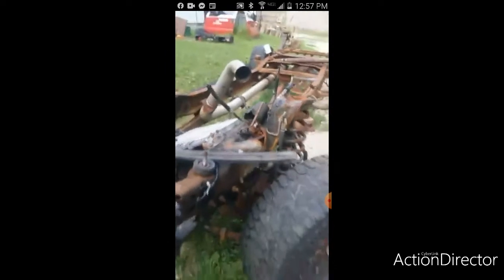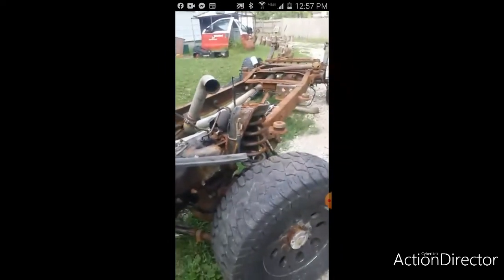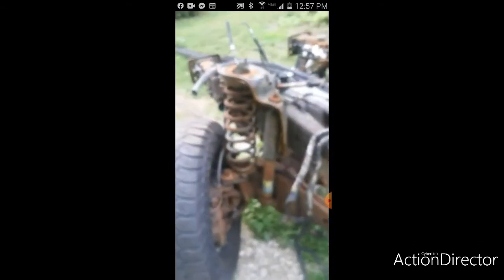We're hoping to get the semi bag in there, but if my semi bag won't fit, we got another bag that will do the job. And it's almost the same width as this coil spring, but just a little bit fatter. So we're gonna be taking that leaf spring setup on that thing over there and going with the radius arm setup, which means I will have to custom mount all this. We're gonna have to redo some stuff and get it aligned, all that good stuff.